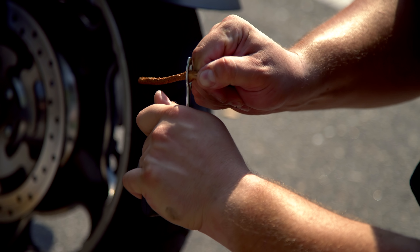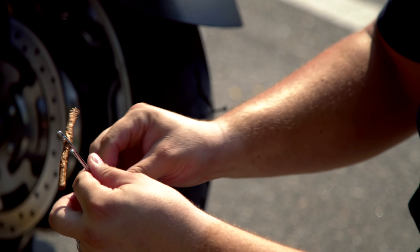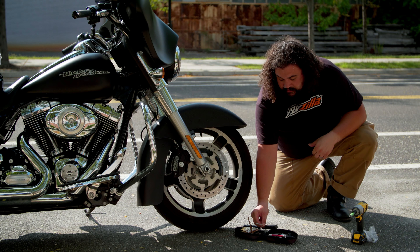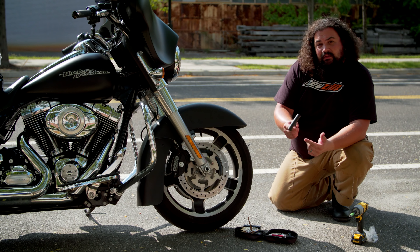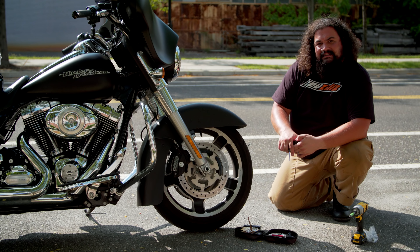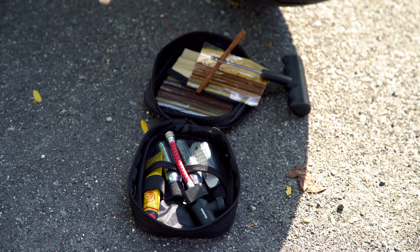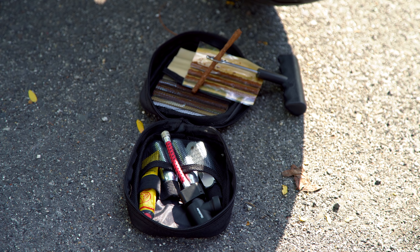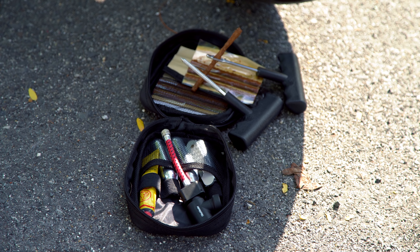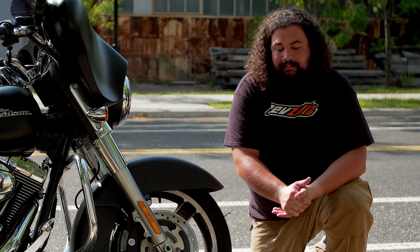Once you've got it in there, you can pull to that halfway point and then set it aside somewhere clean. Something to think about when shopping for a tire plug kit: note that these are T-handled tools, which allow you to throw a lot of leverage into this. This is a physical job, especially when reaming the tire and inserting the plug. A tool with a straight handle doesn't give you quite the same leverage, though straight-handle tools do pack down much smaller.